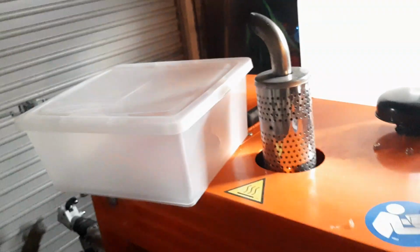I mean, great system. What I really enjoyed about these chippers, sorry for the diversion, is this. You look at this. Can I get the light going on right here? I don't know if I can get a light on. Anyway, there underneath here is a small strip with the grease nipples attached to it. 4 of them in a row. You don't have to dive underneath the machine or open all kinds of side panels or whatever. No, it's all there. You just attach the grease gun to it. I always give them like 3 or 4 squeezes per nipple, and you'll grease the entire machine right there. How great is that? It's a strong little machine and it chips just awesome.